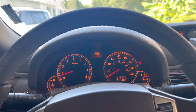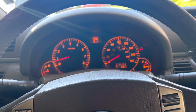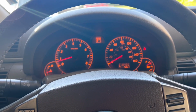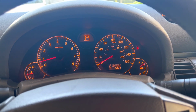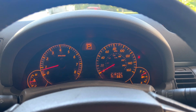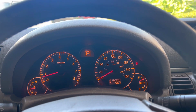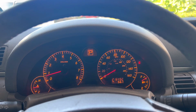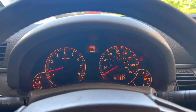Test drive went fine. RPMs are rock solid. Not having the issue with it jumping around anymore. So to resolve my issues, I still don't know why the RPMs are jumping around. Maybe the injectors were a little dirty or something, because all I did was, on the previous day, put some good gas in it, because the car sits up a lot, and I basically put some Lucas fuel system cleaner treatment, you know, those things, on a half a tank, drove about 20 or 30 miles, let some of that get through the system, and after that, the RPMs were not jumping around while I was driving.